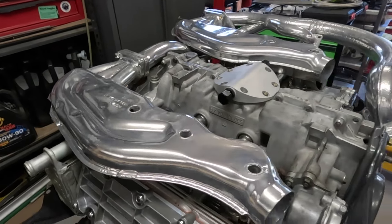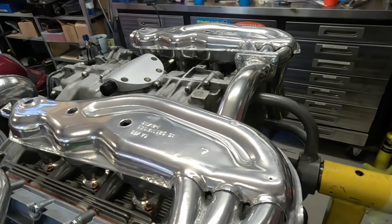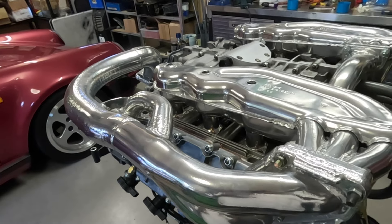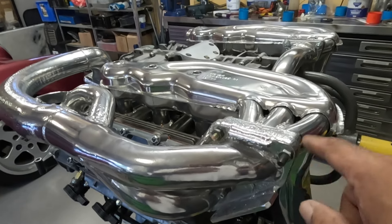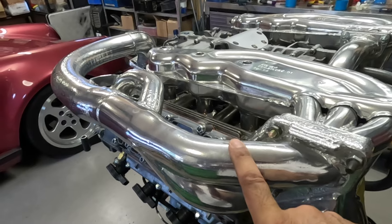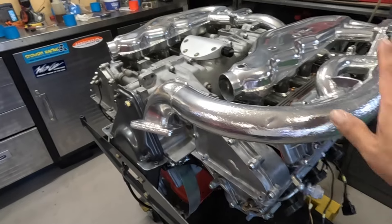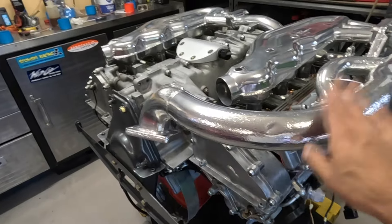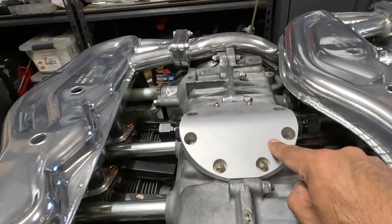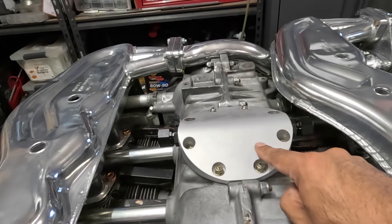I knew I was going to be doing this eventually so I got the ceramic coating done last year. I wanted to make sure it lasted as long as possible and that what was inside was completely clean so there'd be nothing to blow through to the turbo. This is a J-pipe from a 930 - I ordered it from a fellow in the United States because I couldn't find one locally for reasonable money. I had that ceramic coated, had the connector pipe or crossover pipe ceramic coated as well, and there's a custom made piece - a forum user on Pelican Parts ran a batch of these. Not cheap but this should in theory do the job.